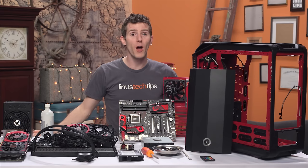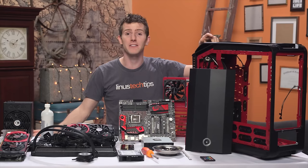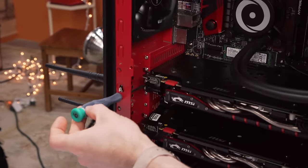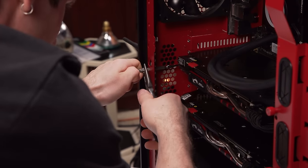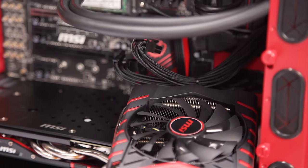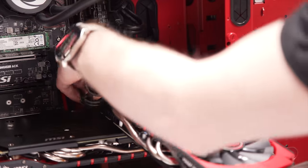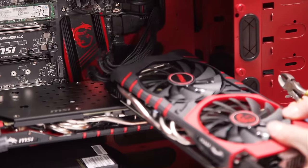The video cards brought about the first challenge in my unbuild. Even iFixit couldn't save me from these skinny holes to reach the GPU screws, so I needed my old jeweler screwdrivers and a pair of pliers to extract them. I also needed some side cutters since the PCI Express power connectors were cleverly cable managed to the fan power for the video card, so they would not move at all.